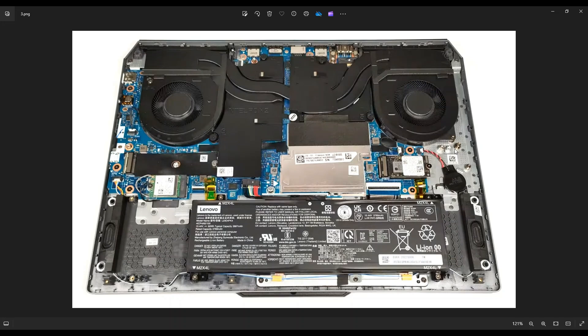If you're here to just reset BIOS, you don't need to physically remove the battery. You can leave it stuck down there — you would just need to unplug it from the motherboard. Maybe 15 to 20 seconds should be sufficient to reset your BIOS settings. One quick side note: this will only reset BIOS settings. This will not, in most cases, reset your BIOS password.